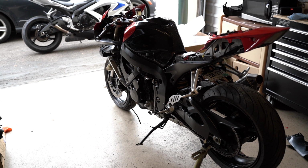I'm going to assume it's the battery though, because I charged the battery overnight, came back the next day, started it, and it started really strong. As it sits, I started it again today without charging it, and it's a little boggy. So I'm assuming the voltage is off a little bit. I haven't even taken a multimeter to it yet, because I want to get it together first and then start diagnosing. It's really easy to take the airbox and throttle bodies off. It takes me like 10 minutes. So that's where I'm at right now.